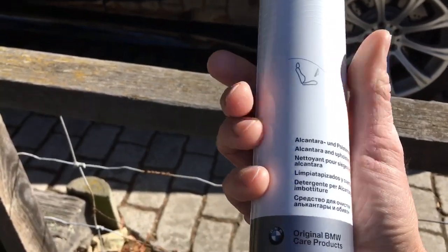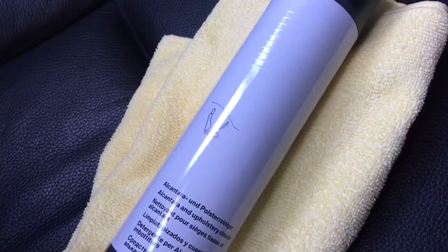Let's jump in the car and make a start. Normally you'd start off by vacuuming the material if it was a seat, but with this being a headliner there's not much loose dirt sticking to it. The biggest thing to keep in mind with Alcantara is that we don't want to saturate it. We'll just spray a small light coating of the cleaner on there and then wipe it with a microfiber towel — not rubbing it in aggressively, just a gentle wipe to remove the soap.